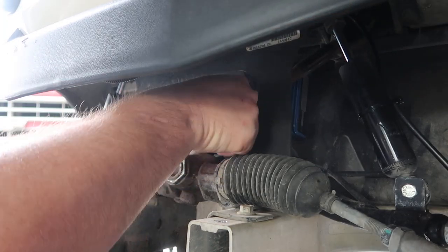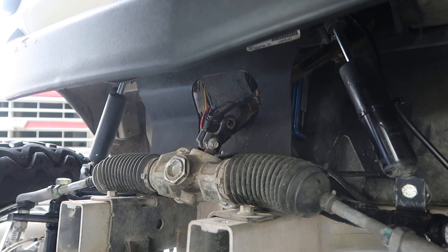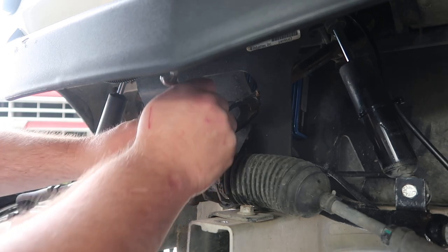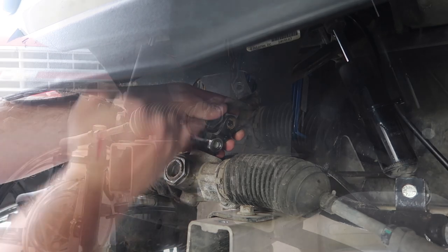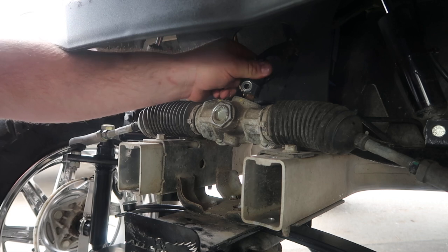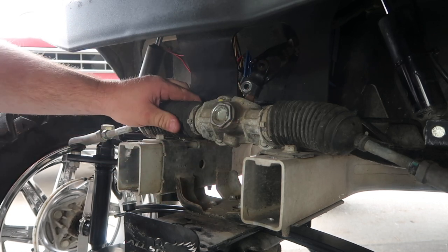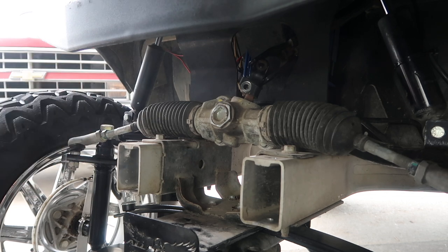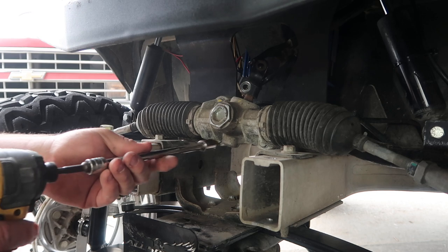To me it looks like the yoke has failed on this. We're gonna replace it using a 10 on this. I can't get the yoke off, so I'm going to take these three bolts on the rack and pinion here and maybe try to gain some more room to allow this to come down. This is a half inch.